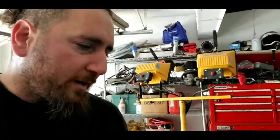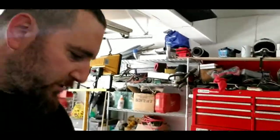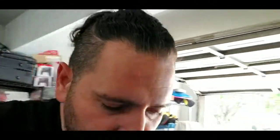You buy your head gasket, copper spray the hell out of it, toss it back on there and you're good to go. This time around I did a quick hone job — a dirty one. I got one of these cool little flex hone brushes, looks like a big old bottle brush, which it pretty much is. I've had this for years, used it on VW's, Hondas, whatever else has a 90mm bore or less.